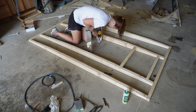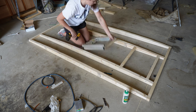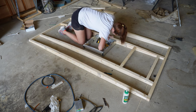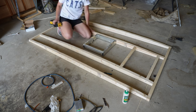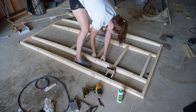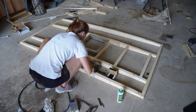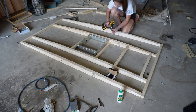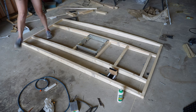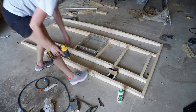This 14 by 14 square actually came out of the original roof, so I might as well reuse it. I drilled some pilot holes and screwed it directly into the frame I'd already made — it was already the right thickness, which was great. If you don't have to work harder, don't do it; use whatever you already have. I'm adding some supports for the sides using scrap wood, because the vent will screw directly into the aluminum piece and I need it to be flush on the ceiling side.